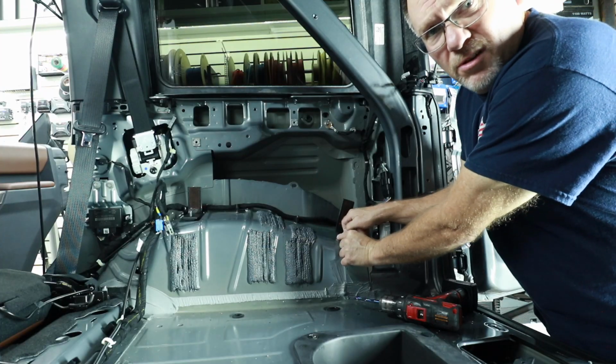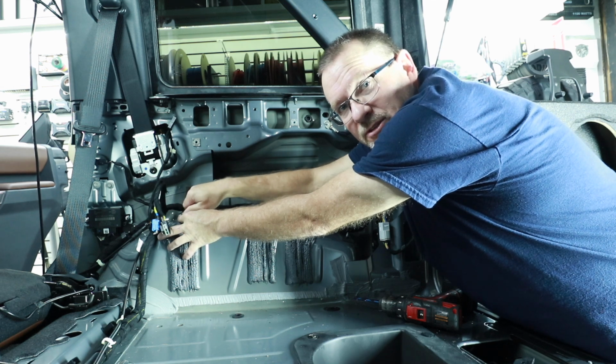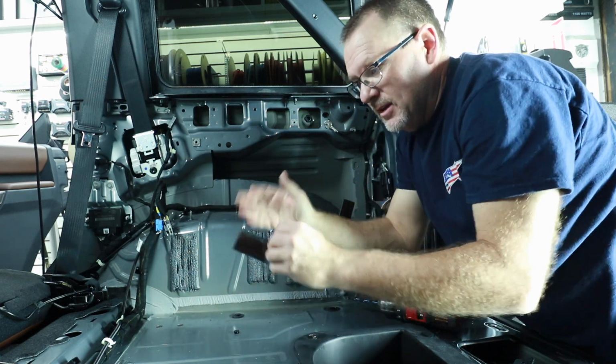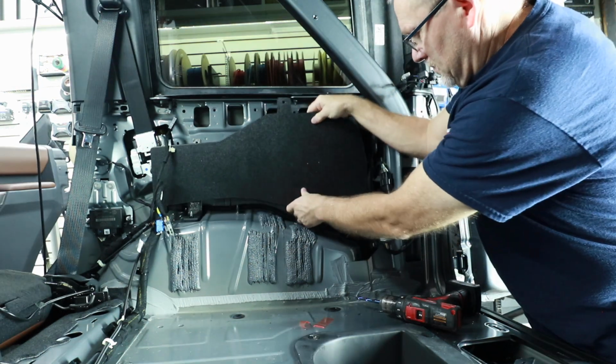The factory screws are an M6. That means I'm going to hand tighten 2 M6 nuts into place. And with the bolt in place and the foam on the bottom, looking at the side profile of this one, it's kind of towing in. So I'm going to heat it back up and bend it out some.